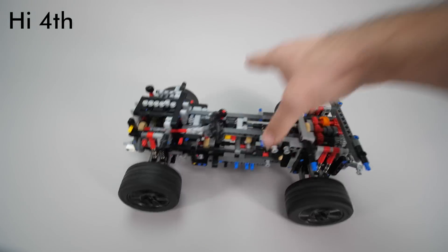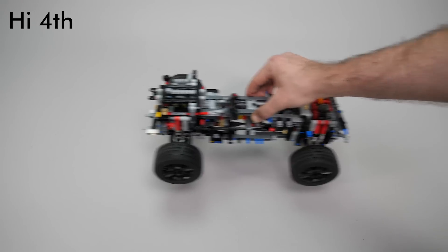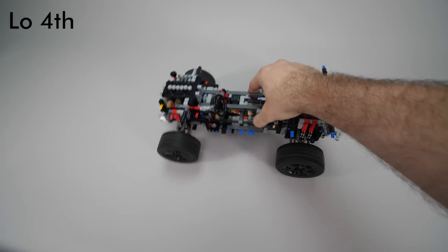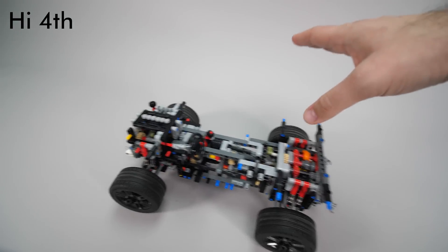As you can see the engine does not run smoothly anymore — there's a visible fluctuation in speed and the drivetrain is struggling to keep up, and vibrations are building up. You can also notice the wind-up effect: the wheels will rotate backwards a bit when you lift the vehicle. It also stops much sooner than in low 4th gear, but that's understandable due to the higher resistance.